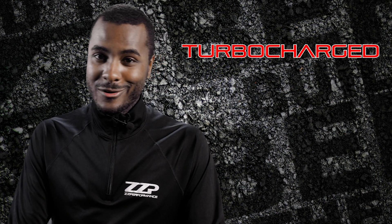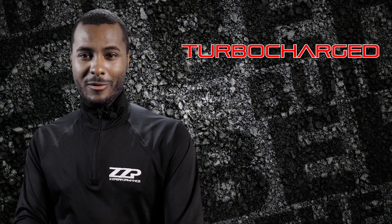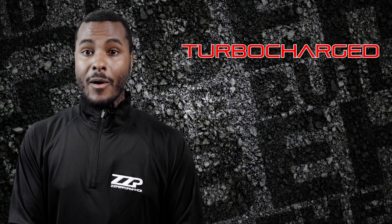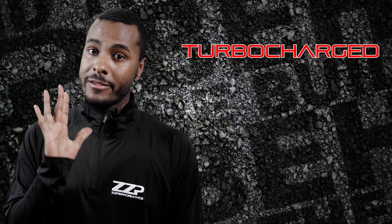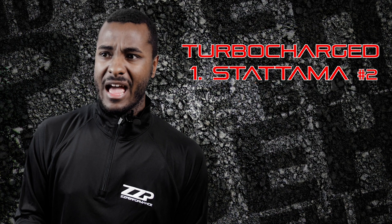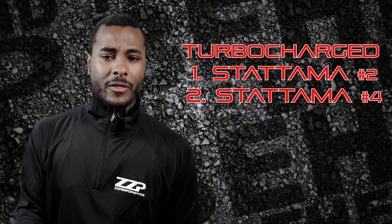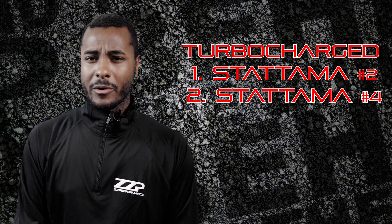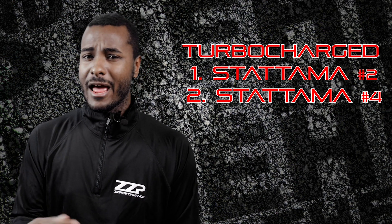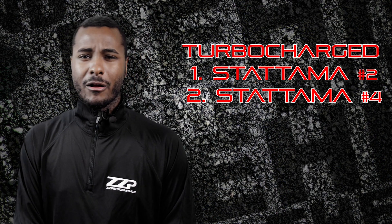Now for turbo guys, you have it pretty easy too. We have our ST cams — our Statama kits. As of right now we have our ST2, ST4, and ST5 turbo cams. The ST2 cam is super light for a street build — pretty much the XP cam equivalent of a turbo build. The ST2 and ST4 both require some valve train modifications: minimum 136-pound valve springs, modified retainers, extra thick front cover gasket, machined oil pump cover, etc. — just like the XP Cam we talked about earlier.